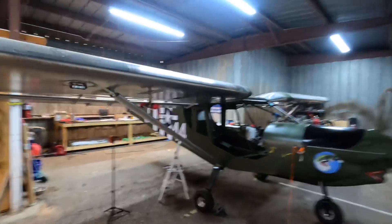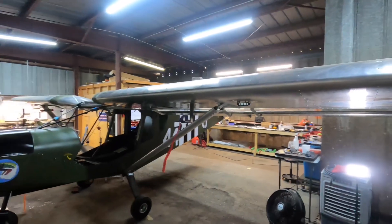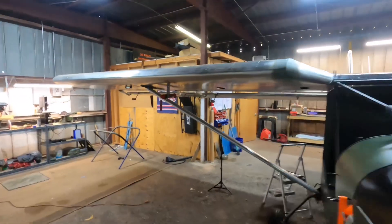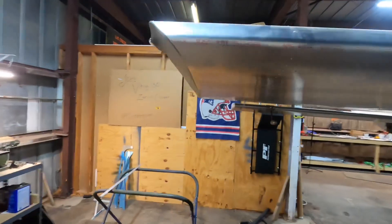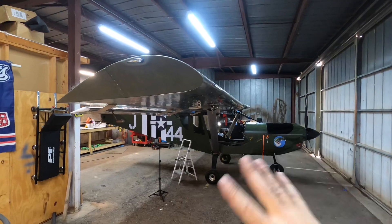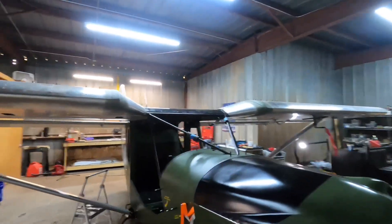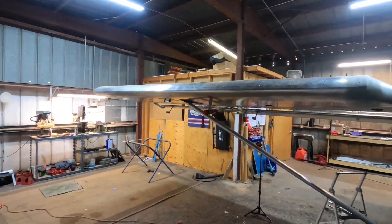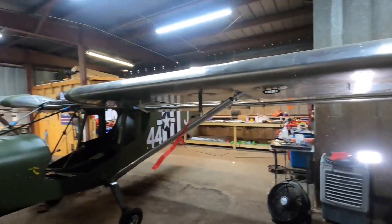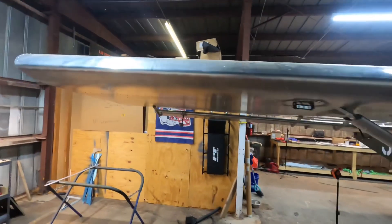I think I'm going to wait on the rigging until we get the plane painted, and then we'll do all the final rigging at that point. Right now, everything has been mocked up and is ready to go. A little bit of trimming will need to be done on the banana slots, but that's about it. I think we're good to disassemble and prep everything for paint before it gets too cold here in New Mexico. We do have winter, and temperatures will drop below 30, which makes it really hard to paint. I have a work trip coming up for one week, and when I get back, wings, tail, everything are going to start getting removed to prep for paint — rubbing everything down with some Scotch-Brite and cleaning surfaces with dish soap, then cleaning everything off with the prep.